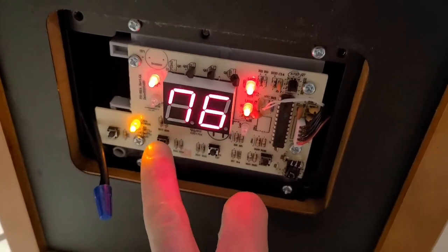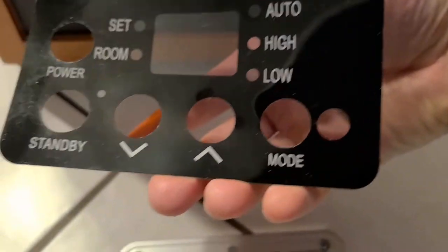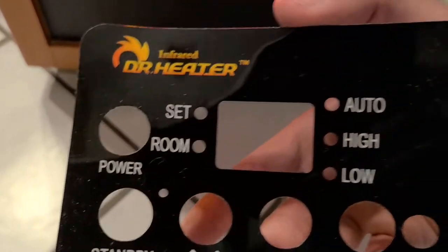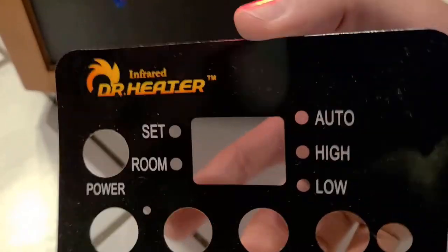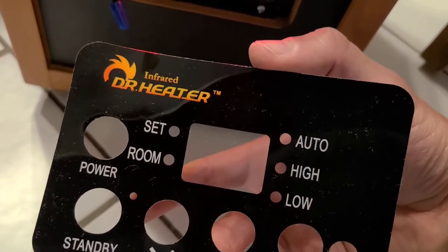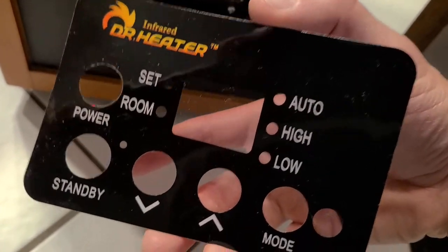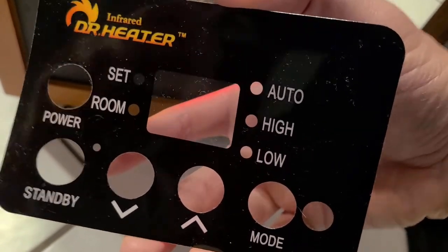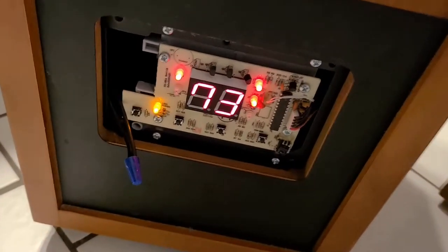This button is temperature down. The rightmost button is mode, and you have up, down, and standby. Basically, what those two spliced wires did is bypass your main power button, so now power is always on. When you plug it into the wall, this particular unit goes into standby mode, as you saw, so you still have to press the button to raise the temperature.